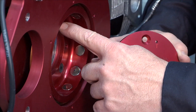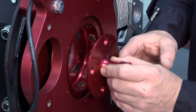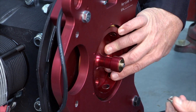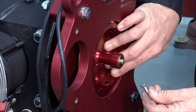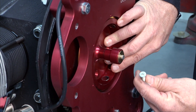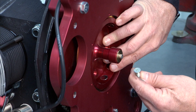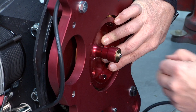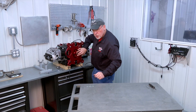You'll align this small hole with the T with a similar hole with a T in the flywheel itself. When you put it on you just align those two holes and the trigger shaft is properly mounted. It is mounted with four small countersunk machine screws — they are also hex head or Allen drive. Those are installed with some blue medium-strength Loctite. Put those in, tighten them up, and your trigger shaft is installed.